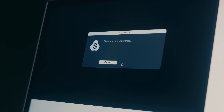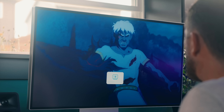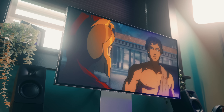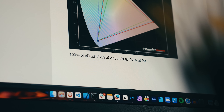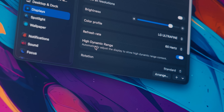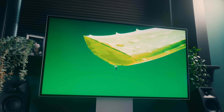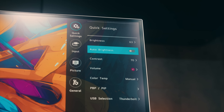The brightness was actually a bit higher than the advertised 450 nits at 474, and combined with the matte finish is more than enough for indoor use, even in fairly bright areas. I've honestly never seen a monitor with that high of Adobe RGB coverage — the best I've seen on a standalone monitor was between 88–91%. And unlike the Studio Display, this does support HDR, although I wouldn't get overly excited about it. The picture might look a little bit better with HDR content, but it doesn't get bright enough to make it pop in the same way that an OLED or mini LED panel would. I don't think that's why you're buying this monitor anyway, but there are some intangibles that I think will make a much bigger difference.